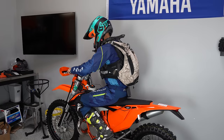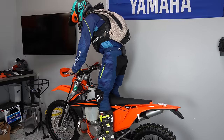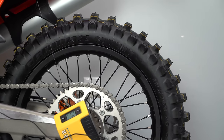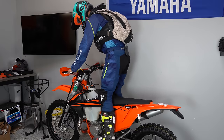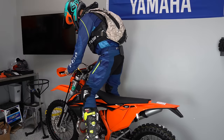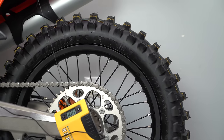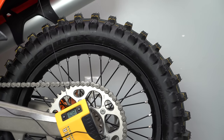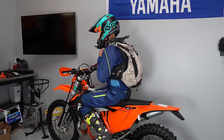When I sit down in my natural riding position, I'm getting 112. I'll bounce, stand up, bounce a couple of times, and in the attack position I'm getting 106. Sit down, I'm getting 110. You'll notice as I lean back the sag goes more and more, so your position on the bike really affects this. If I lean forward I'm at 105; if I lean back I'm at 114. Your position on the seat is very, very critical in measuring your sag.